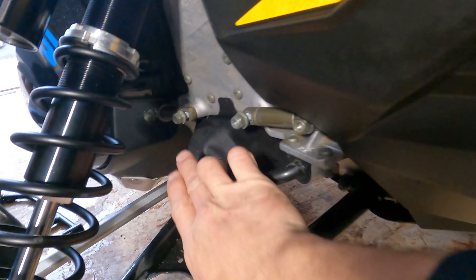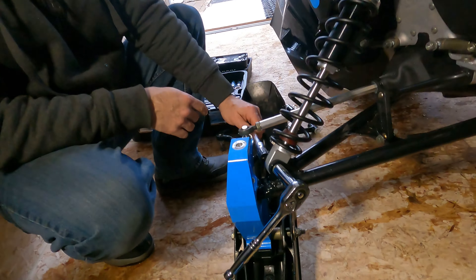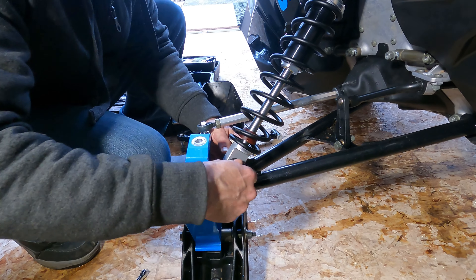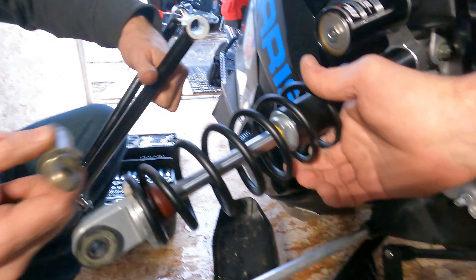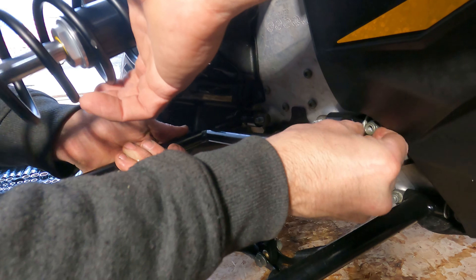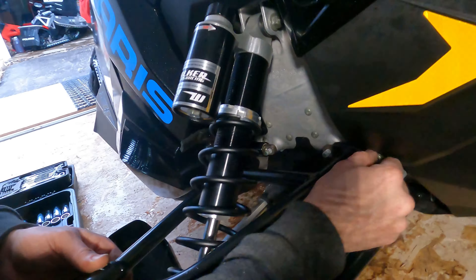This has Walker Evans suspension — it's a 2020 Polaris Indy. They're really running that Indy brand. Looking at the control arm: it's bolted here — it's actually a neat setup instead of a bolt-through. It's just a slice, and there's a removable bushing with a plastic bushing inside the arm. So the bolt holds it together and makes installation easier.